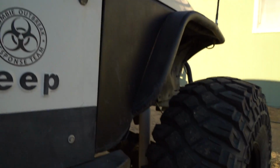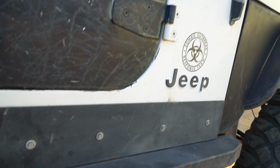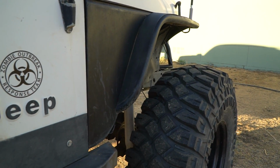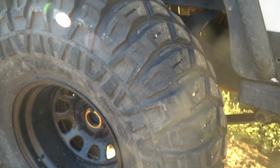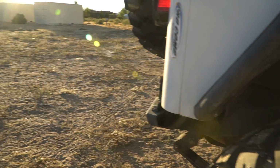So, must have on this Jeep, absolutely. And I forgot to mention I have motor mount lift along with new motor mounts from Daystar as well, and they lift the motor about 1 inch, so gives you a better drive line angle. And they're solid motor mounts with polyurethane bushings, so they do yield more vibration, but it's fine, you know. For off-roading, they do well. Keep your motor. And I also have a Daystar transmission mount that is polyurethane as well, forgot to mention.